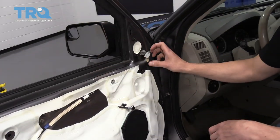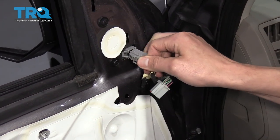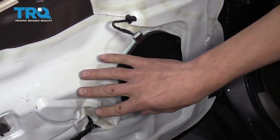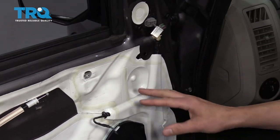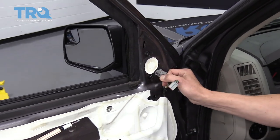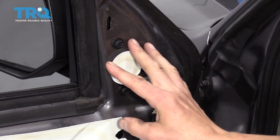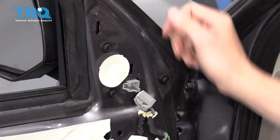With the door panel off, you may have some wiring that unclips right at the mirror itself, or you may have wiring that actually runs down into the door panel somewhere and goes to your window switches — that will define how much work you have to do in this area. In this case, it's about as easy as it can be, with just unplugging this connector here. At that point, you can remove the three or sometimes four bolts that hold it on and then pull the mirror right off the car.